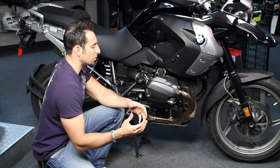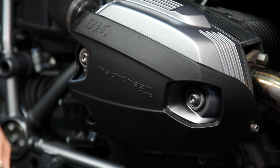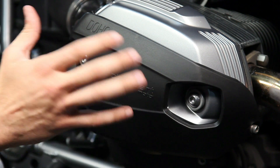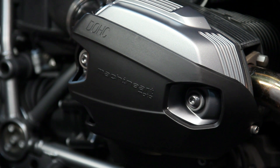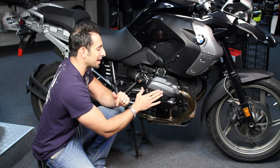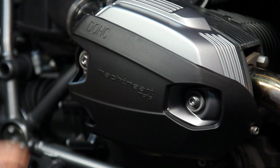MachineArt Moto often uses ABS plastic, but the cylinder head covers on these X-Heads are made out of nylon — the difference being heat tempering, so they handle the heat from the cylinder head much better. They also have a gasket behind them that adds a shock absorption layer, similar to how EPS in a helmet manages energy. That shock absorption layer takes the impact from the outside, transfers it, and creates cushion between the head cover and the head itself.